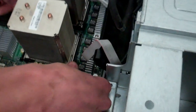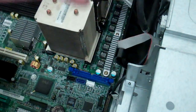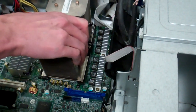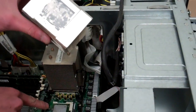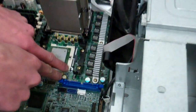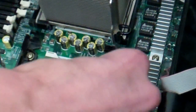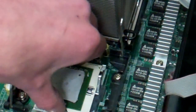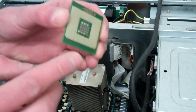Push the clips down — there are clips on the sides of the heat sink that spread apart and lift up. Before you just lift this off, wiggle it first. This breaks the thermal compound off the processor so you don't lift the processor out of the socket and bend the pins. Set that off to the side. Now the processor comes out with the lever here — lift that up and you'll see the socket move. This releases the pins gently. Pull up and you'll notice all the pins — it's very easy to bend these, so set that off into a very safe place.